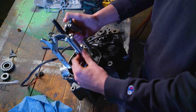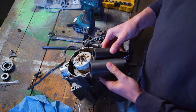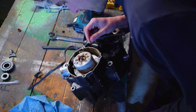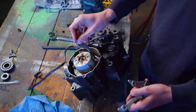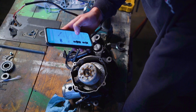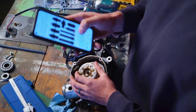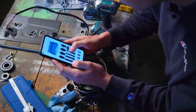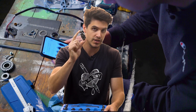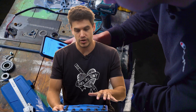I've got to figure out how to pull that out — it's too tight. I have these two pullers but they are not the right kind. I need a puller that has an external thread so I can thread it into this part. I also have these little baby pullers but even these don't fit. So I found a flywheel puller for $16. I'm going to go with the $30 kit so this doesn't happen again. The specific puller for this bike was the M27 XP-1L. I'll put a link to the kit I got and also a specific puller if you just want the one for this bike.